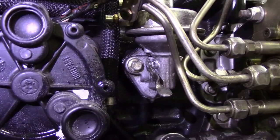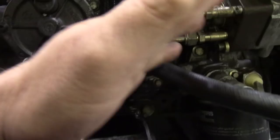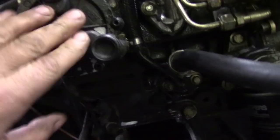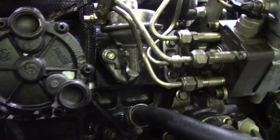You can see some bubbles there. It's the fuel pump that's leaking. As I said, it will leak all the way down here, and as your engine's fan is going it'll blow oil down here and you'll think this other area is leaking — but this is fine, there's nothing coming out of here at all. That's the leak. Am I concerned? I don't know what it's going to be like when it gets warmed up, but it's not good.